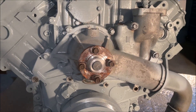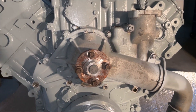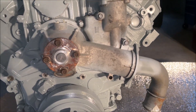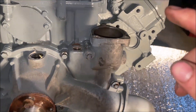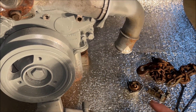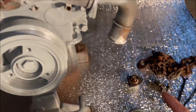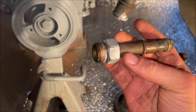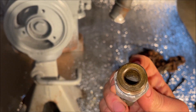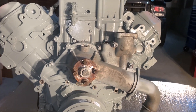So we're taking the old water pump off now. That's the real reason why I didn't paint it. We've got a new thermostat, which probably won't be going on today because I need a caulk gun to seal that properly — I have the RTV. And these fittings might not go on today either because I need Teflon tape, but we're going to at least get that water pump on and keep you guys updated.